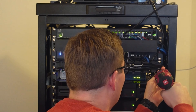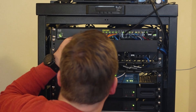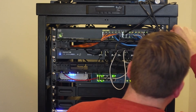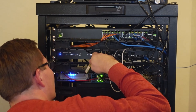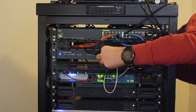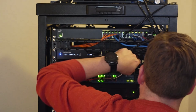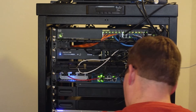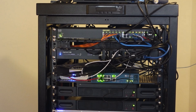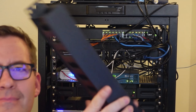By means of this time-lapse video, I'm going to show you guys the process of repositioning the network equipment in the SysRacks 27U server rack. One of the first steps of phase one was removing some of the equipment from the server rack. Here I am removing one of the Panduit units that I had mounted underneath my 10 gig switch. One of the nice things about having redundant uplinks from my VMware ESXi hypervisor host was I was able to simply unplug one uplink from each host one at a time with everything running, so I could get the cabling out of the Panduit unit and remove the unit.